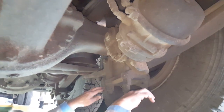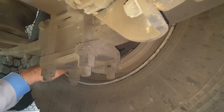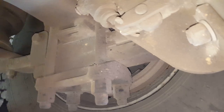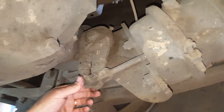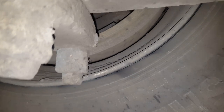When we look at this side, the linings are metal to metal — there's hardly anything over there. When we come across, we look at the pushrod length in particular over here, which is a fair fitment for a vehicle like this. We move to the axle behind it and we can see that this pushrod is fully extended, but the brakes are not applied either. We can see there's also no lining on, but the shoe is right on the drum.